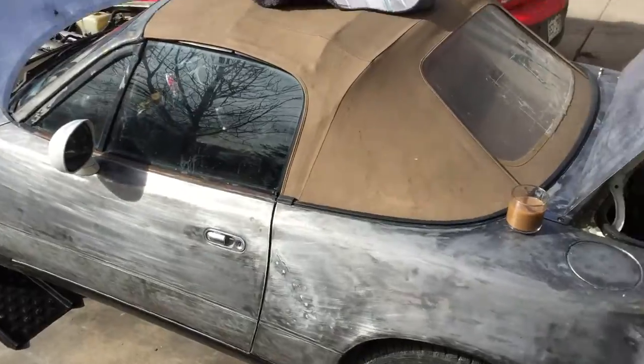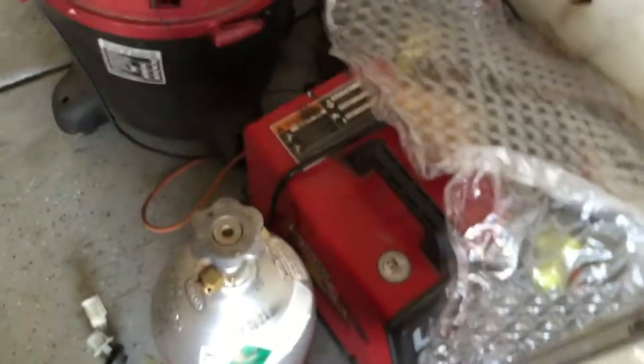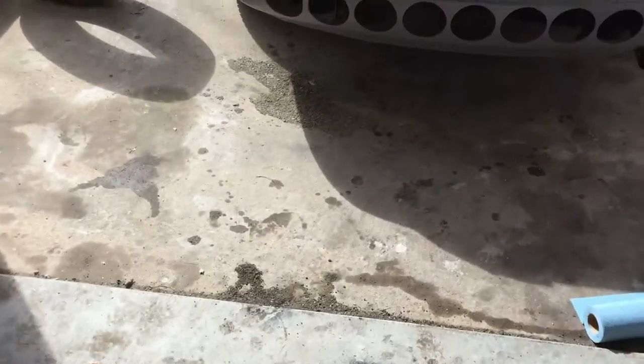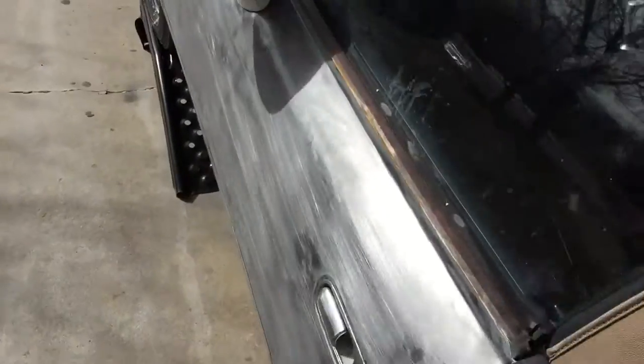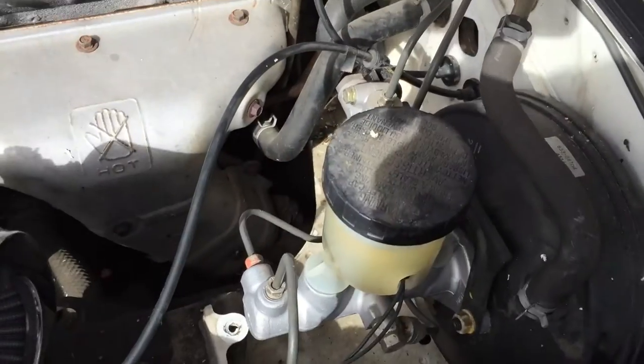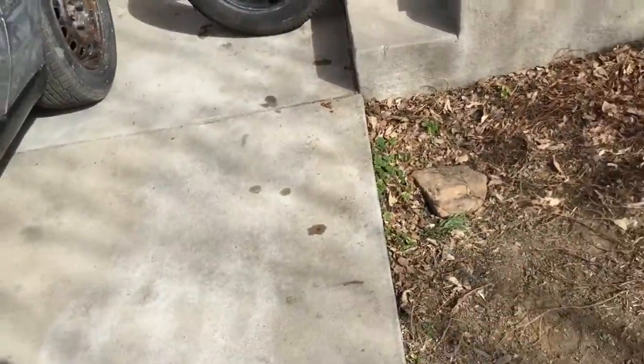Out here doing the Speedo cable — letting it fill with oil, taped into the tranny side with some oil, and then it drains down through the cable, hopefully preventing any future wear. The old one was not properly fastened to the firewall, so it was just hanging down on the back of the block and the exhaust. Clearly that's why it failed.